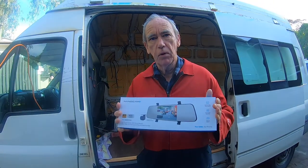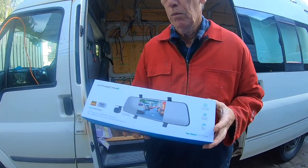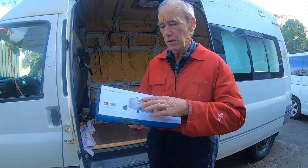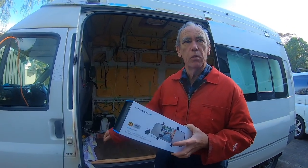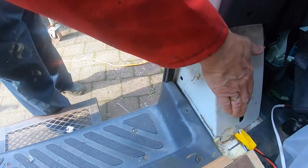This is the reversing camera I've bought — it's also a dash cam. The display clips over your rear-view mirror, and it's quite good resolution: 1080p for the front and 720p for the rear camera. The control unit goes on the front mirror, and I can run the cable from inside the van to outside through where I put in the gauges for the water tanks, then through the headliner, down the pillar by the seatbelts, down here, out along the bottom, and run it underneath.